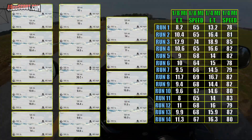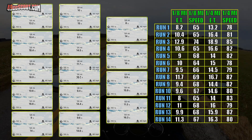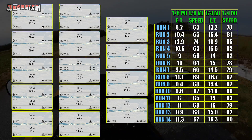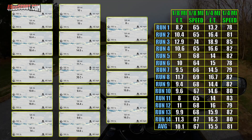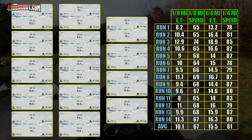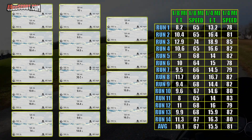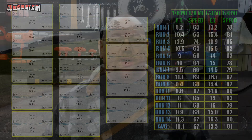I did 14 runs on the T-Max with the GPS Race Timer app recording 8th and quarter mile times. I think the results here are even more confusing than they were for the small scooter. The quarter mile times varied by over 5 seconds and many were much quicker than I think it is. Once averaged out I think the 8th mile time should be close, but I doubt that I'm doing 15.5 in the quarter. I've seen results online between 16 to 17 seconds for a stock T-Max with lighter riders, and I do have lighter slider weights and mild porting, but I'm also heavier. I even tried a few test runs in a car and a truck to see if being on two wheels was somehow responsible for the strange results, but I had the same experience.